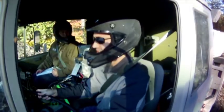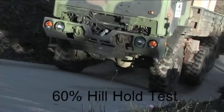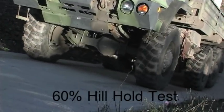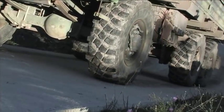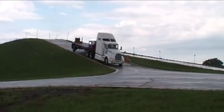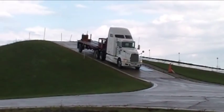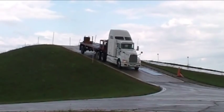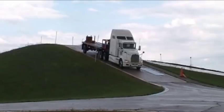The Century brake drum has undergone rigorous testing in both the laboratory and at a third-party vehicle testing facility. After initial break-in of the drum surfaces, standard DOT hill hold tests were performed at 60 percent and 30 percent grades with the vehicle holding its position. The test was carried out facing both uphill and downhill. In all cases, the Century drum exceeded the required hold time at maximum gross vehicle weight.